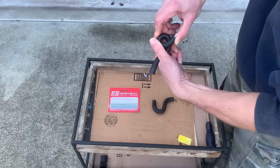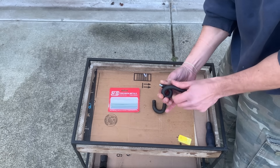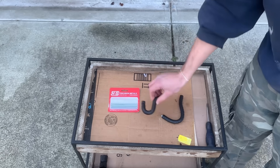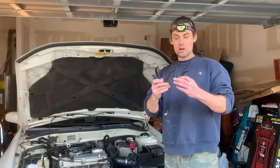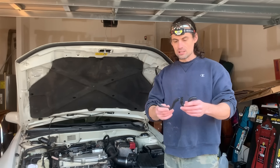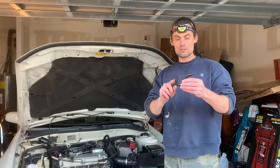Even now as I release it, you can see the shape it preserves. This was a mistake I made and learned from. Once I did it right, it looks just as good. I already put it in the engine where it belongs — you should be able to see it's not kinking anymore. It goes in a nice rounding U shape. That is how you bend your hoses without kinking. It takes a little bit of practice. If it doesn't work the first time, it will work the second time. My first hose was a little kinked; my second hose was absolutely beautiful and almost as good as the OEM part.